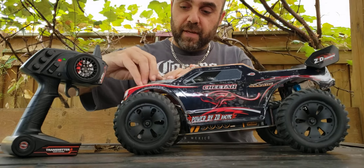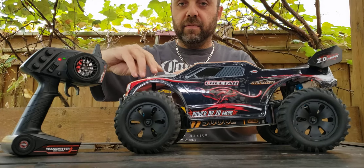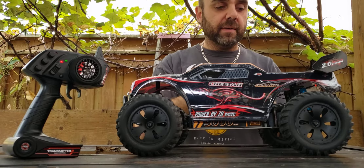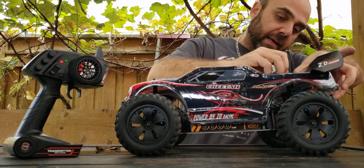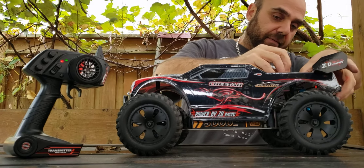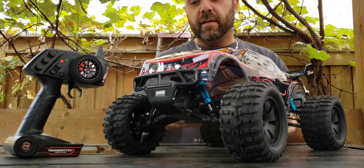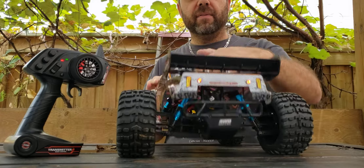Just to refresh from the last one: I've done away with the 3650 5900kV motor in favor of a 4370kV motor. I've added 7mm hub extenders in the back to make the track out back more in line with the front. The shocks I kept as the ones from my first update, which are the HSP 94111 Brontosaurus shocks. And I added LEDs front and rear, which are quite nice — so I can actually drive it at nighttime now.